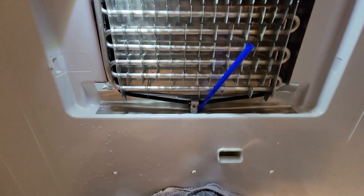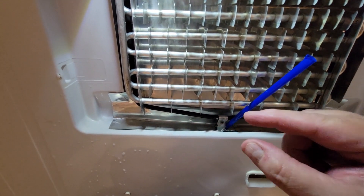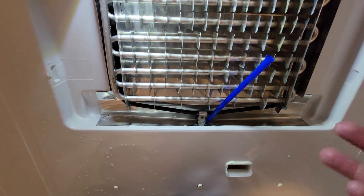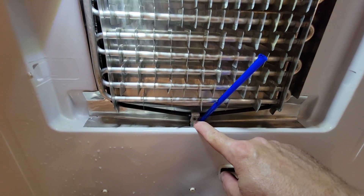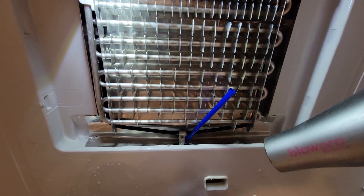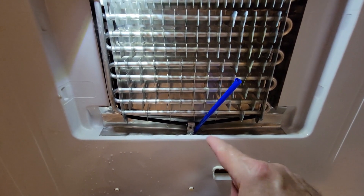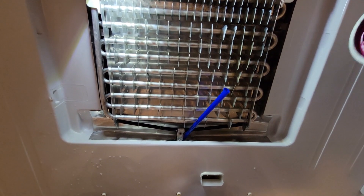Okay, so I've been pouring hot water down in here and it hasn't been working. And this metal piece — this is a straw, by the way — this metal piece is so short. It doesn't hardly even go down in the hole. I don't know how come our Samsung refrigerator worked for 10 years without having this problem, but now it's having the problem. This piece is definitely too short. This metal piece that heats up — this straw — is only going down this far. But I've been taking this hair dryer and blowing it on the end of the straw. You can even see where the straw is starting to melt. But every time I blow it on the end of the straw, I can push the straw down into the hole a little bit further. So I know there's ice buildup in the hole — that's why it's not draining. So as an example, let's do it right now. I'll finish this up and show you guys what I'm talking about.